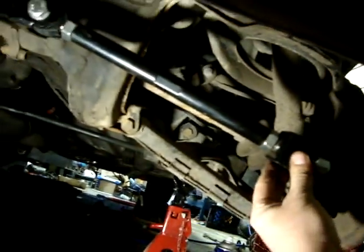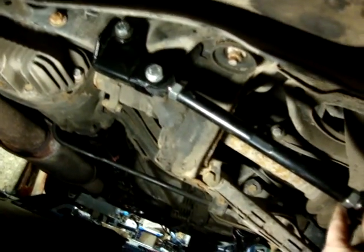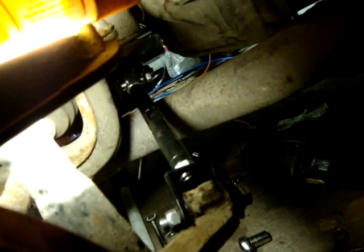That's how you remove all the steering and lines — I hope this helps everybody. Make sure you torque these pretty tight; it's your steering, you don't want it to come loose and go all wanky. Here's the other side — it went an awful lot easier than the other side. I just heated it and it slid right out, then bolted the new one in. Remember about the alignment. That's how you remove your rear HICAS steering. I'm sure it's the same in other models — just make sure you get all the proper stuff. Don't forget to like and subscribe.